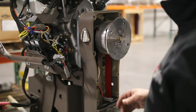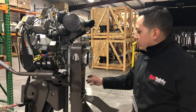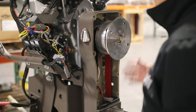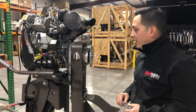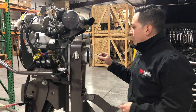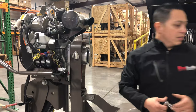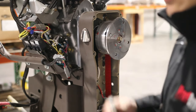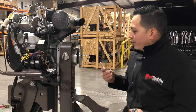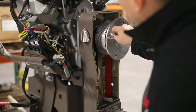What we want to do right now is loosen up the tension on the belt. This is going to release the tension completely on the belt. Now I'm gonna take this bolt out, and then I'll show you how to remove all the magnets and everything. Check the description for all the tools you're going to need. I'm going to grab a half-inch bolt and this is how I'm going to lock my transmission.